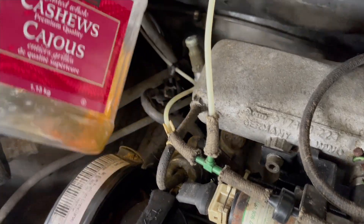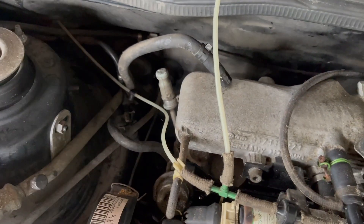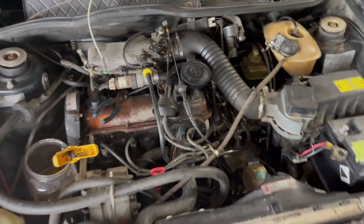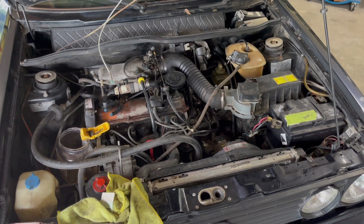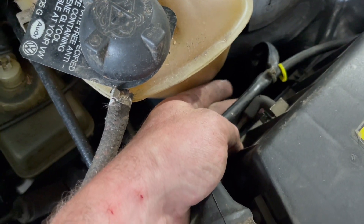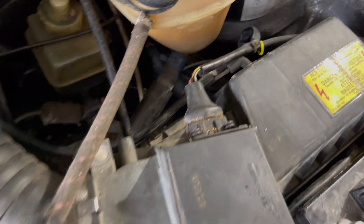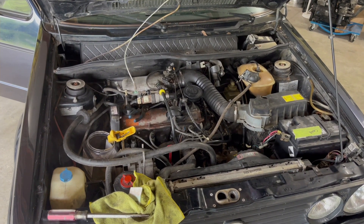Gross. So what I'm going to do now is drain the tank from the back of the car and go get some fresh fuel from the gas station, and we will see. I'm thinking positive things here — I'm thinking this might just work. We have fuel. Maybe we don't have spark, but hopefully that was tied into all that mess of wiring. Everything else I've connected — I connected the idle stabilizer valve that was undone before, I connected all the lines. The only thing that's missing is a little elbow at the bottom of the airbox for some of the hot air recirculation, but it's not even going to affect the car in the slightest. Anyway, let me deal with this fuel situation and we will try and turn it over.